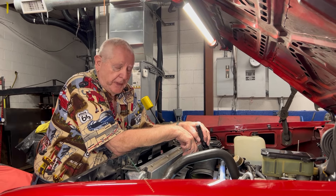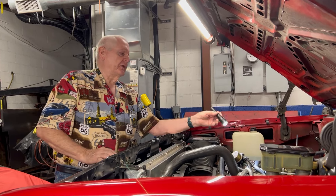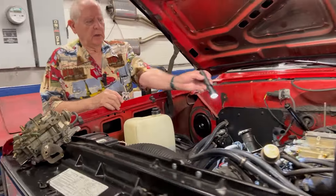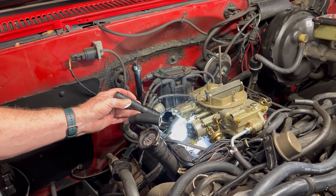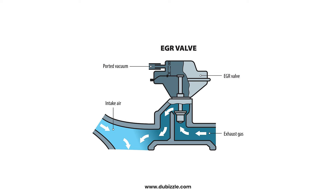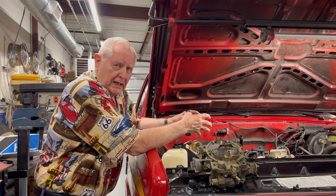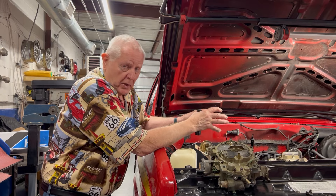But the shift pattern didn't really have much to do with the pinging. So the next thing we did was put an EGR valve on it — it goes over on the side of the engine. Right there is the plate where the EGR valve would have gone. We actually put one on there to see if that would have an effect. The EGR valve recirculates exhaust gases back into the engine, which reduces the mixture concentration so it doesn't blow up so quickly. It actually cools down the cylinders during the compression stroke and keeps it from pinging.